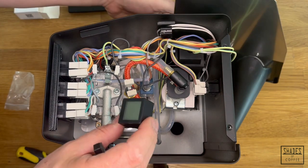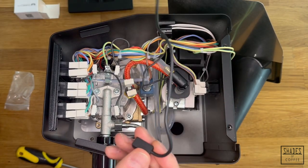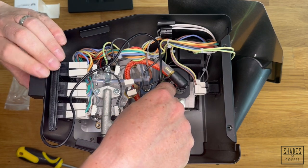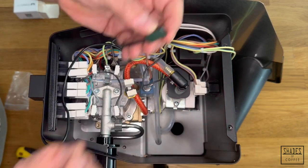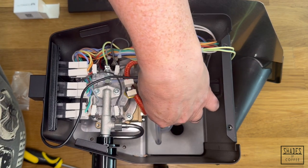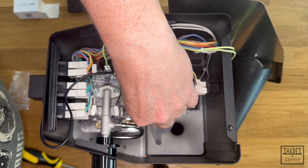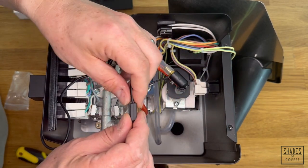Installation is really simple. Once we've decided where the solenoid valve is — on the classic it's down here — we want to install the sensor so we can easily route the cable from the sensor through to where the Krona Cube is mounted. We want to mount the sensor vertically, in the same orientation as the solenoid itself — about halfway down the solenoid valve, fairly squarely in the middle. We'll be using the adhesive tape to do so.